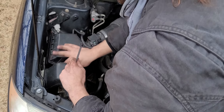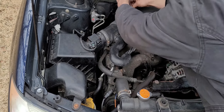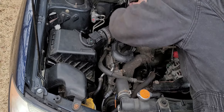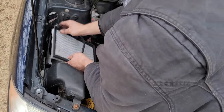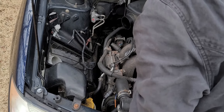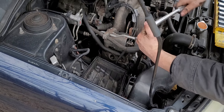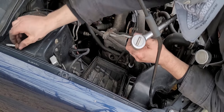Now we're going to switch to the passenger side. Remove the MAF sensor connector, undo the two clips on your air filter, because we're going to be removing the air intake. There's a hose clamp closer to the air box which is basically sitting atop your throttle body, and then the whole air intake gets removed and the air filter gets removed. There's still not enough space to work.